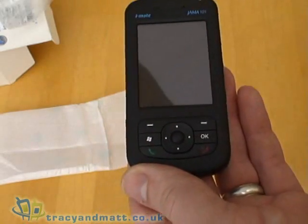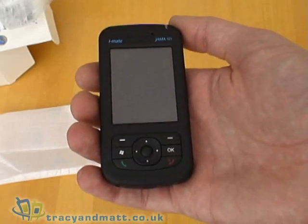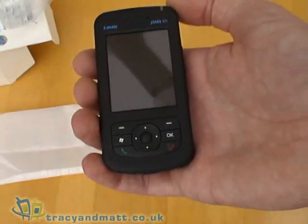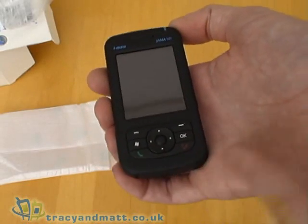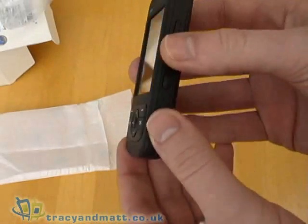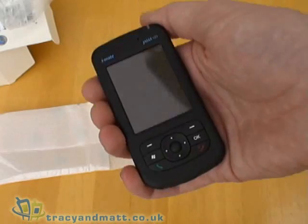The specification is fairly basic as this is designed as an entry-level device. It runs Windows Mobile 6 Professional, with 64MB of RAM, 128MB of ROM, and a 300MHz processor. It is only tri-band, not quad-band, and only has GPRS — no 3G or HSDPA. There is a microSD card slot to increase storage, a 2MP camera on the back, and built-in Bluetooth. Other than that it's a fairly standard Windows installation — nothing terribly exciting, but this is a basic entry-level device. We'll be looking at it over the next week or so and will be back with a full review soon. Thank you.